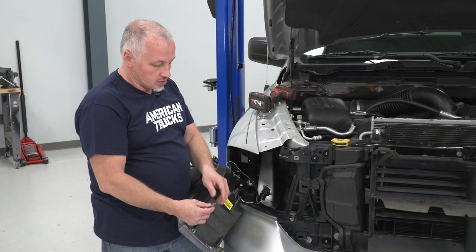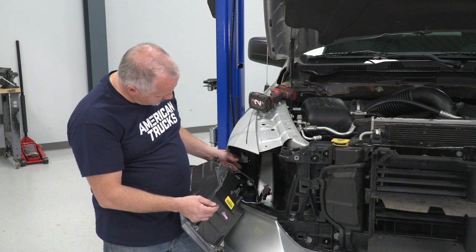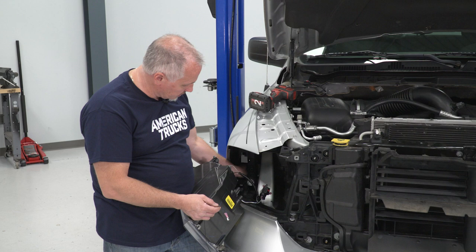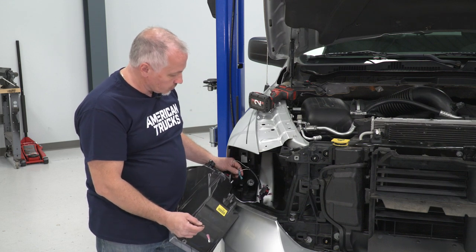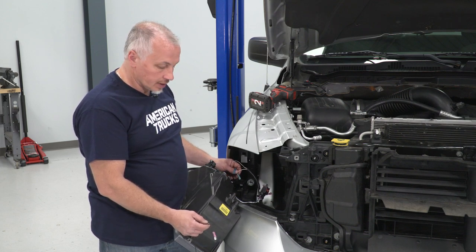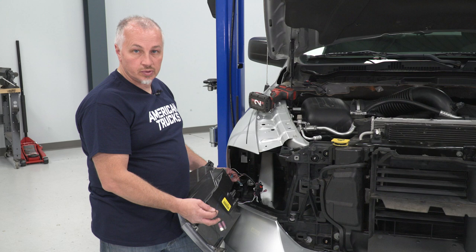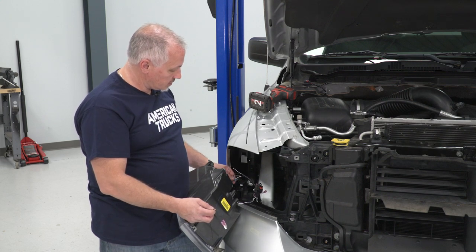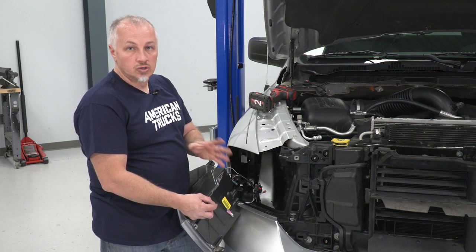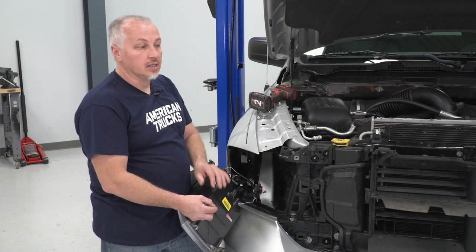To be able to hook this up, I had to remove my headlight. To remove the headlight, take this bolt out here and this bolt out here — there's a clip underneath that you pull down. You can reach through the wheel well right up in here. Then you're gonna get in here to your turn signal light, right here in this corner, and tie into the two wires for your running lights. In our vehicle, we already have connectors, so I'm gonna tie into the black wire and the white wire with the orange, and those lights will come on with our driving lights or running lights.